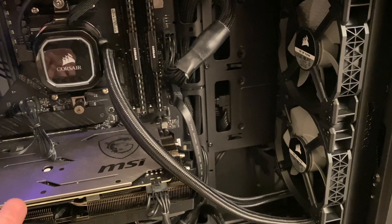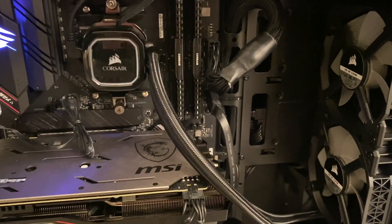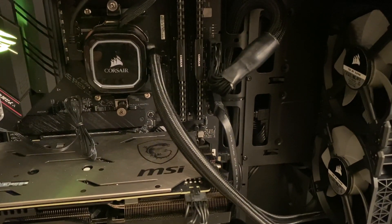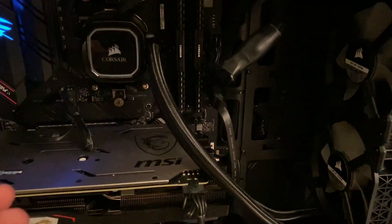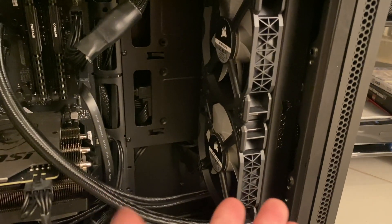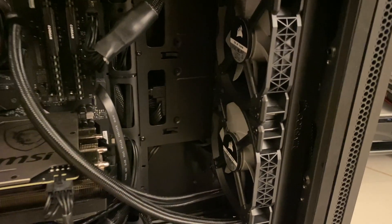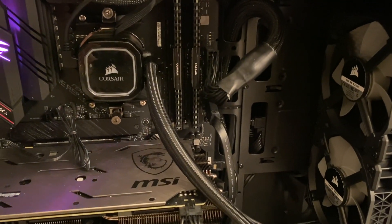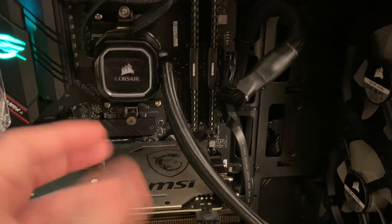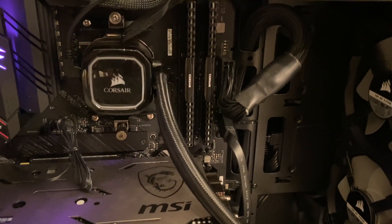Which eventually will kill it. Now, if you've wired in your Corsair pump properly, then you won't have to worry because your computer won't boot if the pump doesn't work properly — that's the way it's wired up, which is good. But when you paid 100 quid for an H100i cooler, you don't particularly want to break it by pumping air through it. You'll know if it's got air pumping through it because, as he showed in his video, it was making a very worrying, clicky noise where the air was getting trapped in it.